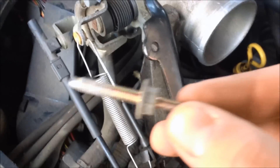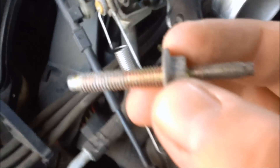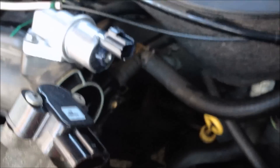Here's the bolt I'm talking about — it's a 10-millimeter deep socket extension right there. Then it's the bracket, and it has an 8-millimeter nut on the front of it, on the left-hand corner. Once you take that out, you can remove your throttle body cover to get to the sensor, which is held in by two Phillips head screws.